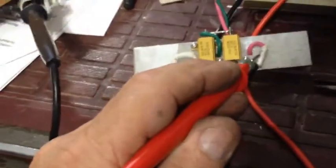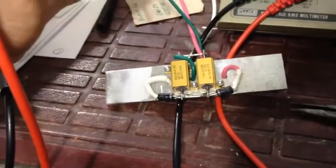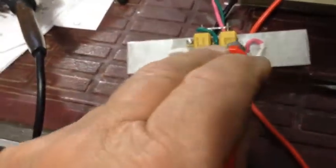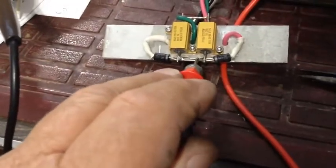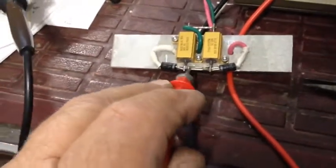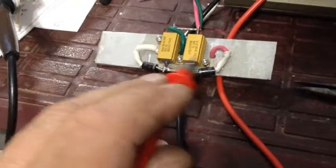So now your turn signals will work. The way this works is: the right TSM will send a signal out to the right side of the bike, and since this wire is tied into that socket, it sends some of that current to the resistor block. Current passes through this diode, goes to ground, and adds extra resistance as needed to make the turn signal flash. The diode also blocks the other side so current can't pass through in the same way.